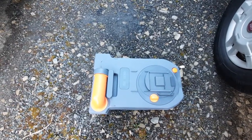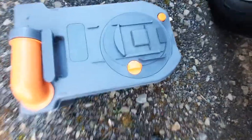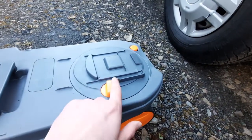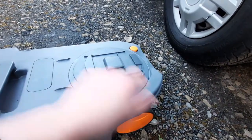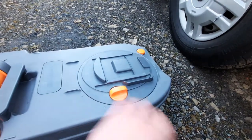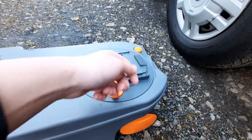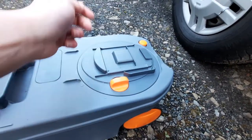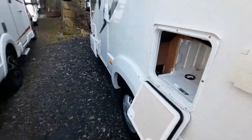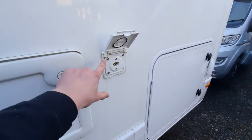The final aspect of the cassette is a second orange handle, which makes contact with the blade — once the blade is open, it turns and opens the cassette so waste can drop in. That should always remain in that position; you never need to touch it. If you turn it and try to push it in, it will get jammed, so just leave it as it is.